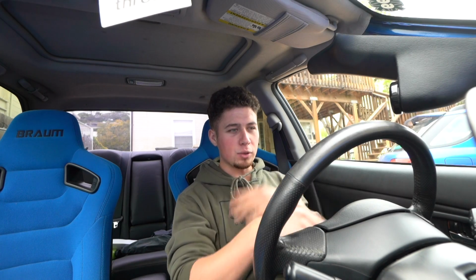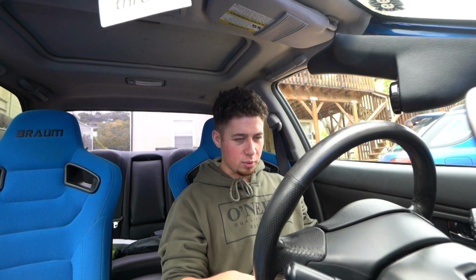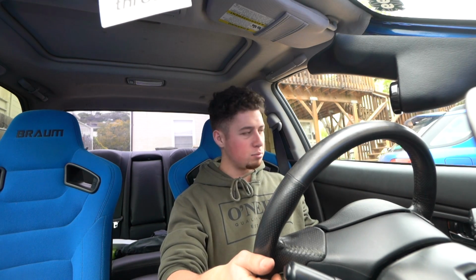Everything dies. Now keep in mind, I started the car multiple times when I was doing the power steering thing, right? So that was totally fine. Once the car touched the ground, I try to turn it on. Nothing. I get one click, everything dies. I'm like, what the hell? Go out to my battery. My battery has 6 volts. And I was like, what the? Did I just pop something? Did I blow a fuse? And my starter relay? So I start looking at all these things.